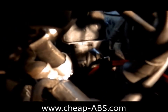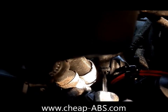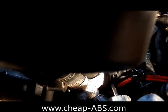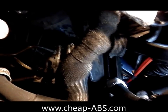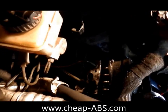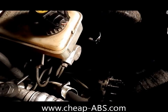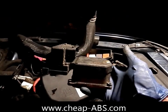Once you get to this point, you should be able to remove all the screws and get the module off. After you remove the screws, you see this connector with a tab right here — it's a clip. Take a flathead screwdriver and very gently pry this out. There's a two-wire power connector that comes out the bottom — that's the last thing you'll need to remove. Now we've removed all six screws, removed that small two-wire power connector on the bottom, and we can slide the module right off the pump. And now, finally, we have the module out of the car.